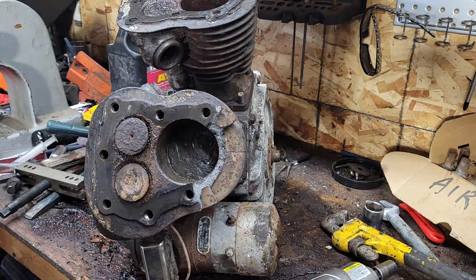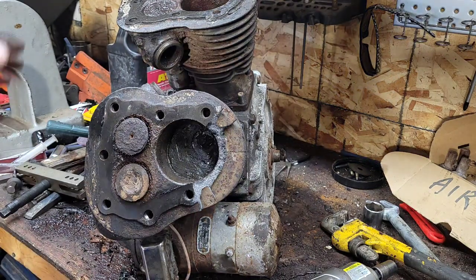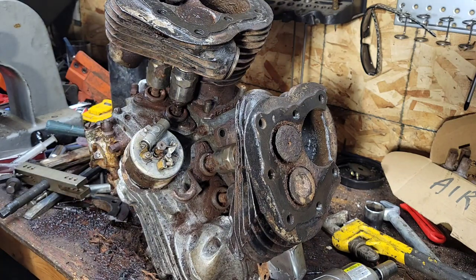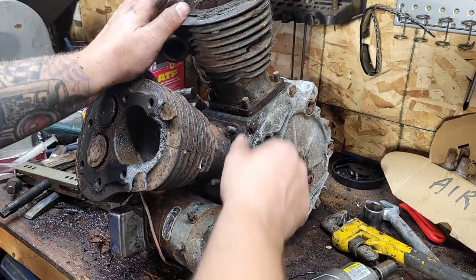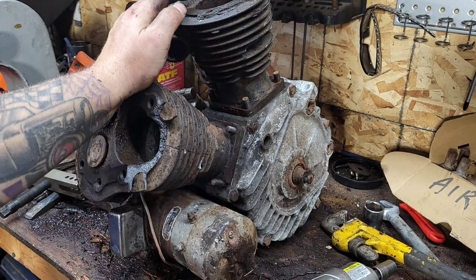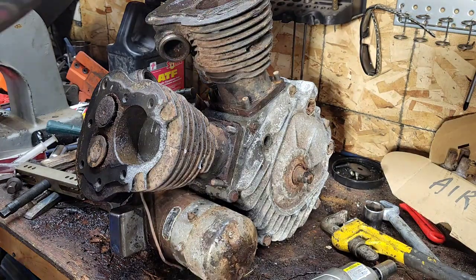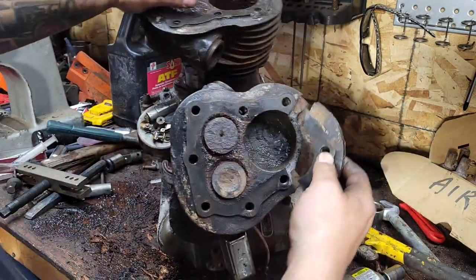If I've got to work on it a lot, then that's the way it's going to be. Kind of sad but it is what it is. This thing might be too far gone. The tappets are all seized, so I can't get the tappet blocks off until I take the top end off. I can't split this thing without literally breaking off the tabs on one side, taking all the nuts and bolts off, and splitting the cases - then I'd have a loose crank. And if I can't get at the wrist pins, I can't take this crank apart anyway. If this thing becomes a lamp, at least I have the piece.